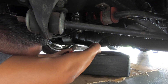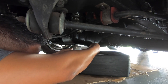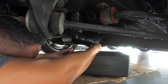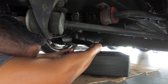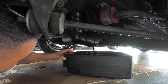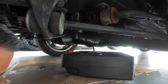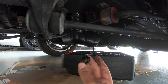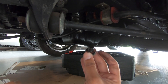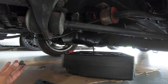These really don't need to be super tight, so I can already hand-loosen this. I can see that the washer is bad on there, which is probably why it's leaking. It's coming off — I got to pull my hand out really fast so I don't get any oil. There we go, that oil is coming out and it's coming out pretty quick. So I need to get a new washer while I'm at AutoZone — I'm glad I'm letting this drain while I go, because I wouldn't have thought to get one otherwise.